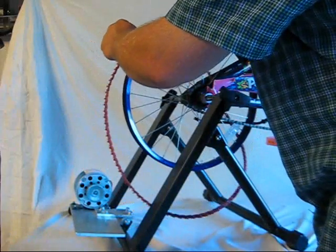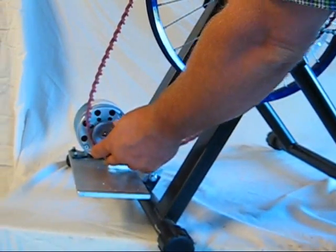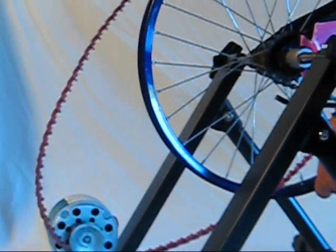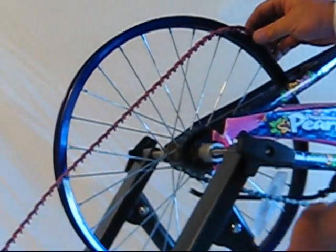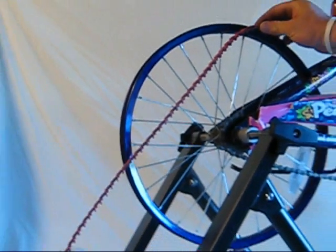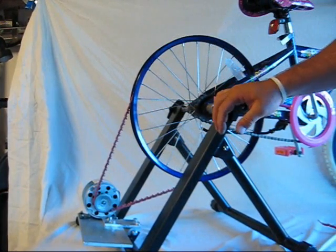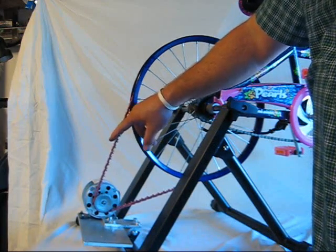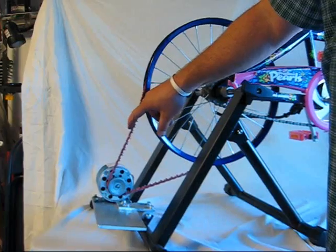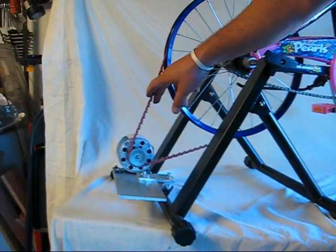This length is mostly correct, but you'll likely need to adjust it once or twice to get the tension just right. First, put the belt on the generator pulley, then roll it onto the rim. You can see it's on part of the rim but not all of it — to roll it on, hold it at this position and gently move the rim to roll the belt on. You know it's correct when the belt deflects about one inch when you push on it gently. If you're in the 300-watt range with a real adult, you'll need it tighter; for a fun kids' display, this tightness is about right.